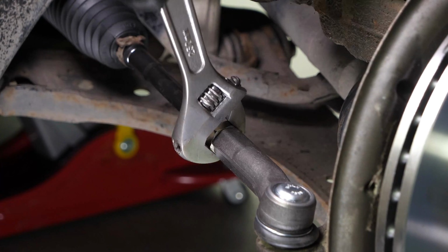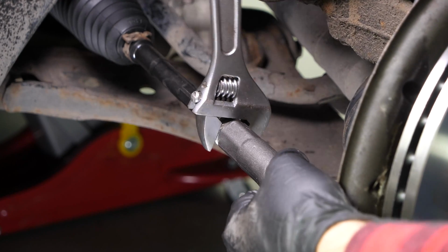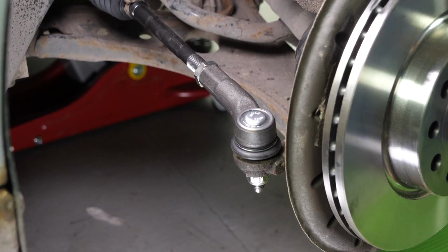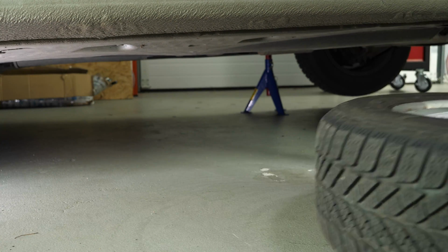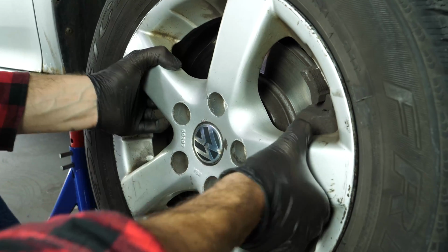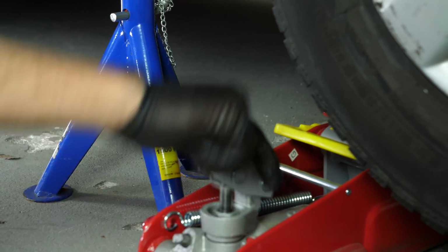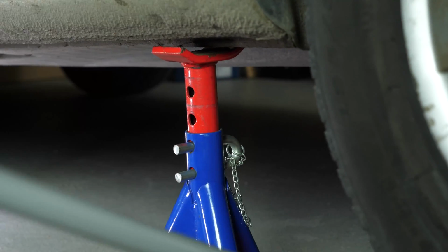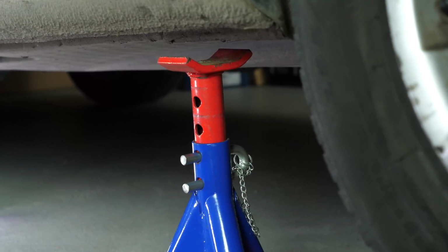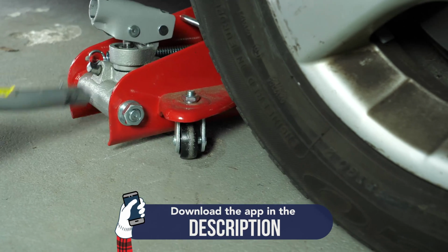Screw the lock nut onto the tie rod end on the side of the tie rod axle joint. Then, you will be able to put the wheels back on your vehicle, putting it back on the ground before properly fixing them in place. During this operation, you will work on the steering system of your vehicle. Checks on tyre alignment, when carried out by a professional, will guarantee that your steering system has been perfectly aligned and is in good working order.